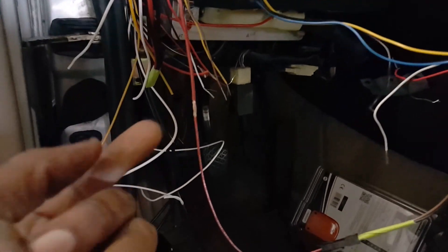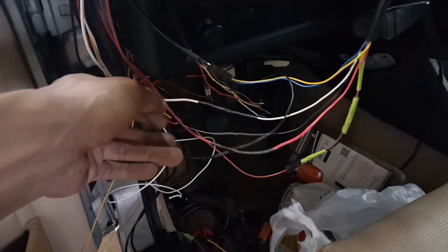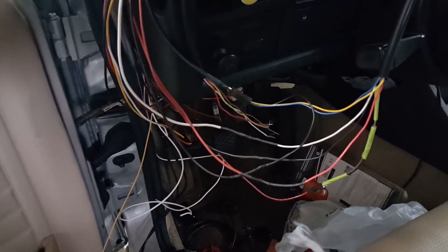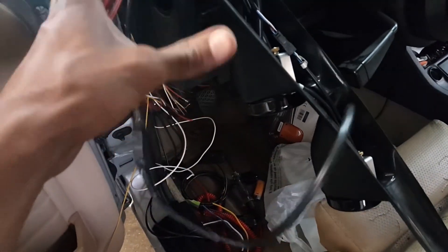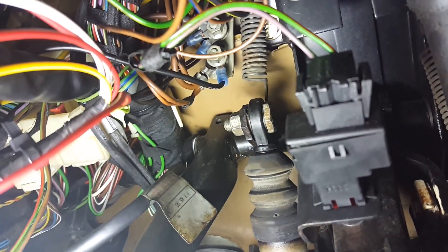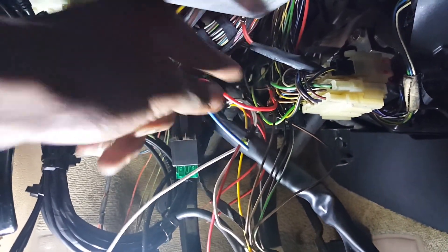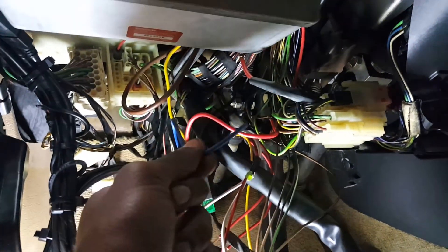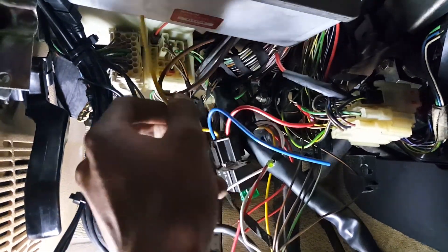Here's how I'm going to set up each of the wires: shrink wrap and connect the two wires, then solder them together — doing that for each and every wire. I got the first set of wires soldered and heat-shrunk. I went underneath here for the grounds for the gauges and the relay because they conveniently put a post for the grounds there. Right here I'm tapping into the ignition wire and I'm going to resolder it back together with the fuse holder. Then I need to find one more wire for the accessory so it tells the relay to turn on.